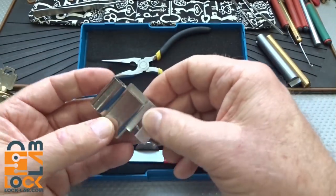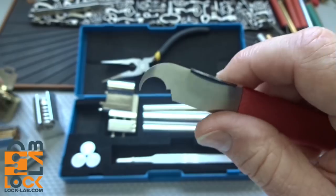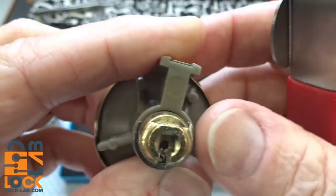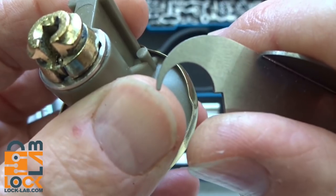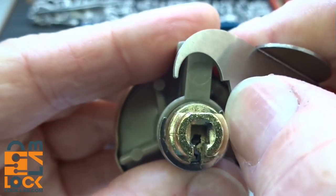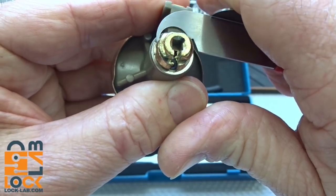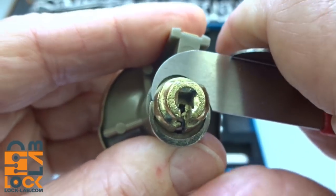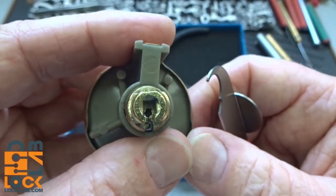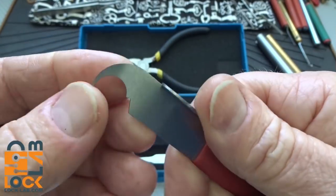We also have a circlip remover. I finally found one that's perfect - this is a stock circlip, not one of those weird ones from Lowe's or Home Depot. This tool has a little cutout and then what I call the beak, or the sharp end. You fit the circlip into that little notch, and then the beak lines up with the other side. Push down - it's going to unlock the circlip. You place the beak in and lever the circlip right off. Much better than trying to use a probe or screwdriver and gouge a hole in your finger. Very nice, seems pretty durable.